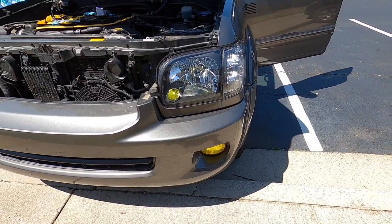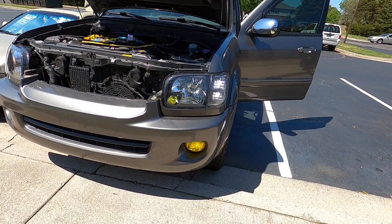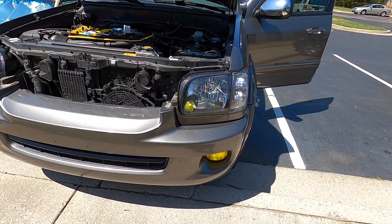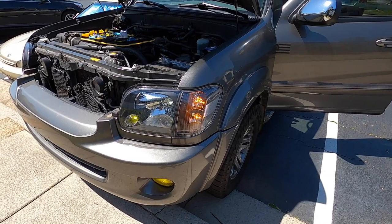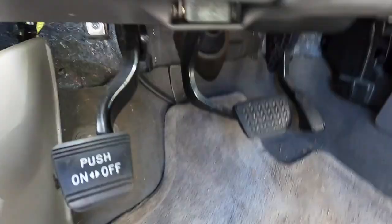As you can see everything is working so far — the fog lights are on, those lights are on matching perfectly, the LED headlights and the corner lights. This is how it looks during the daylight. If you turn on your headlights, the daytime running lights do not work — thank god since I unplugged that. The turn signals are hyper flashing, but once we put the relay in that'll fix that problem.